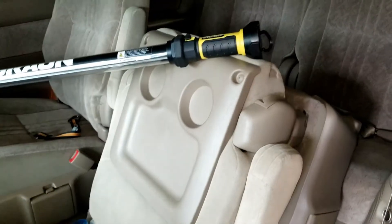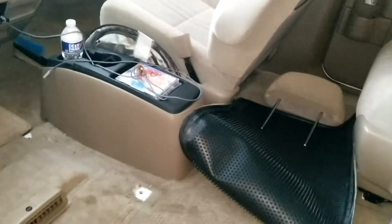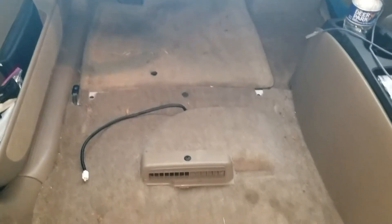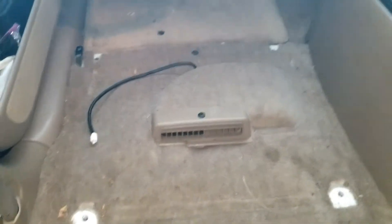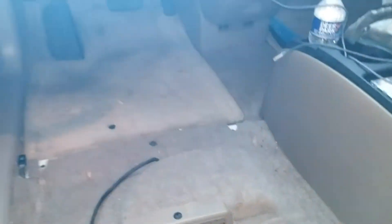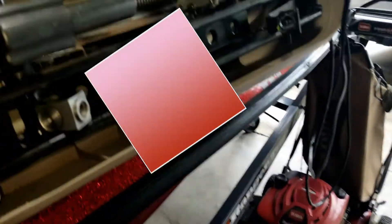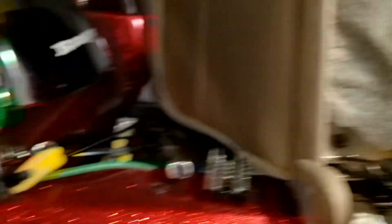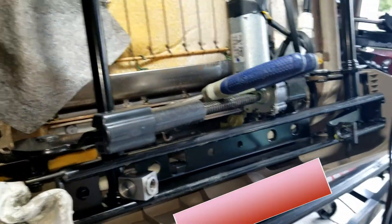Things are out but I can show you what I have and maybe that will help. The front passenger seat I've removed and set back a little bit to give me some more working room here. The seat comes out fairly easy other than it being extremely heavy — at least for me, old man. There are four bolts, two in the front, two in the back, and then there's just this little clip that you squeeze, and you can take the whole thing out. I've moved it and used that as my work area for right now.